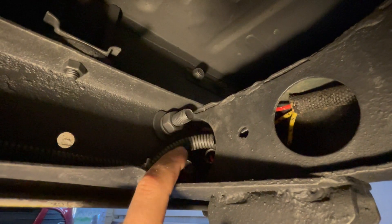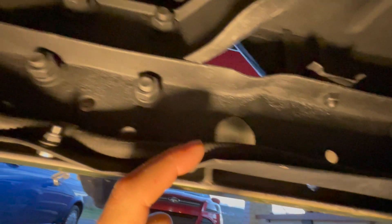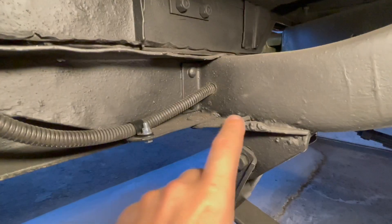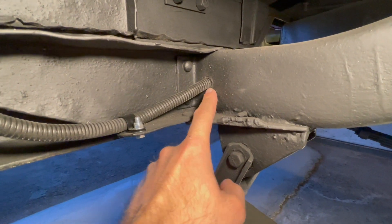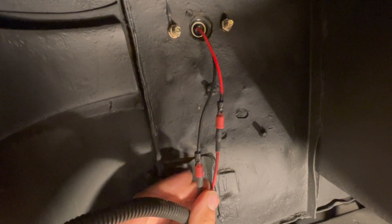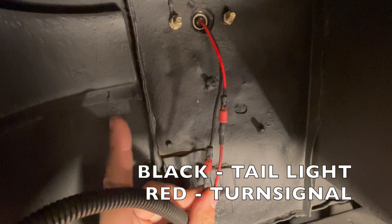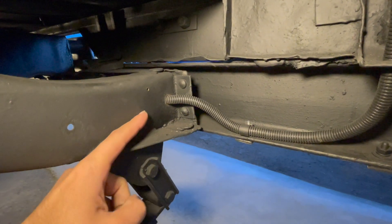Matching the colors with your rear light harness, feed the wire all the way through the back side of your bumper and keep going until you get to the other side. You have to drill a hole and the wire will keep going up and attach to the wires on your rear lights — way up there where my finger is pointing. If you are using aftermarket rear lights, I would use these simple push-in type terminals so if you need to change the light out you can without having to rewire the whole back harness.